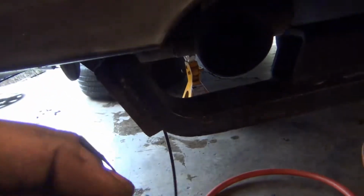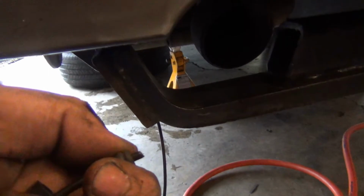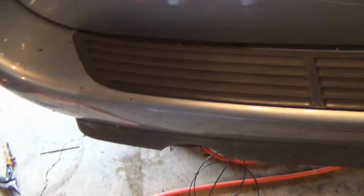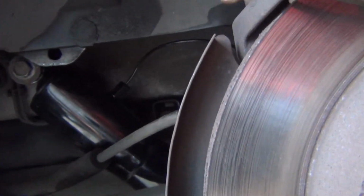And you can cut this line to whatever length you need. And see this here? Little thing is not crimped on or anything, and you can move it around, so it's good there. And putting the lube on the O-rings helps them go right into the air shock. Got it pretty much snug. It's a plastic fitting, so be careful with it.